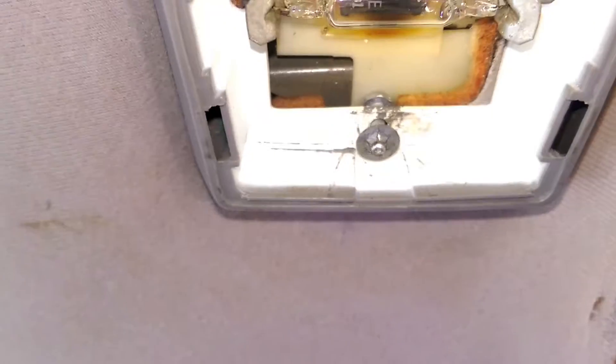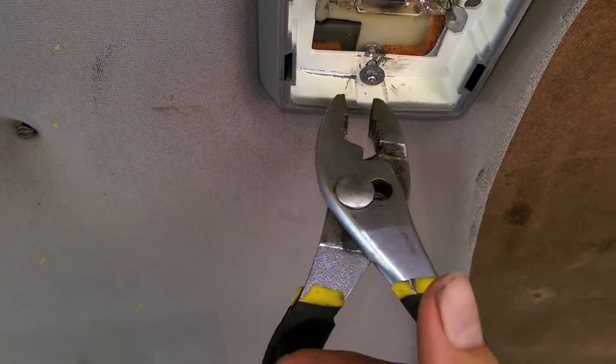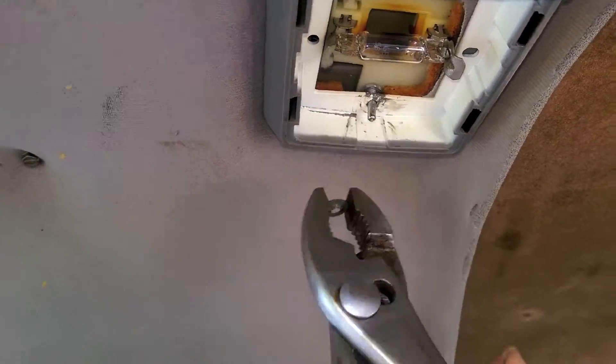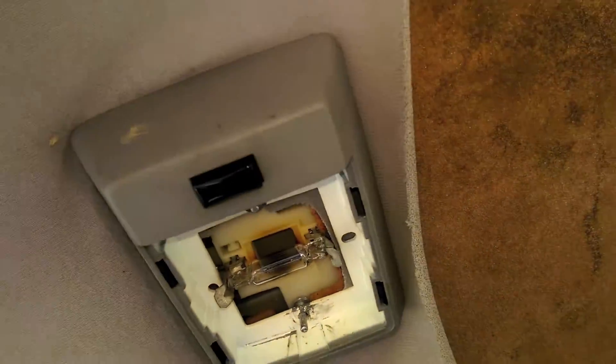For the dome lights, your goal is to get this thing off that little metal round tab. Use a pick or whatever and try to pry it out carefully — you can't really pull on it because the roof comes with it, it's very weak. Once you finally get it down a little bit you can use some pliers to work it the rest of the way. Be careful because it's going to want to go flying, and these are really important if you ever want to put the dome lights back on, so don't lose them.